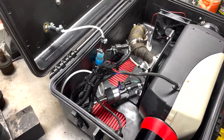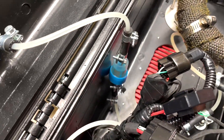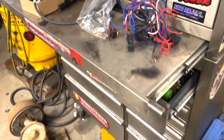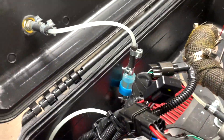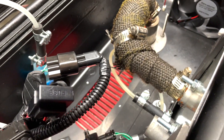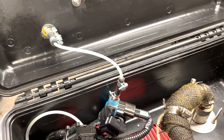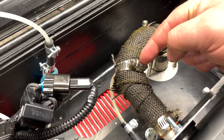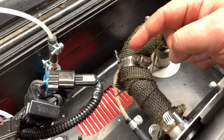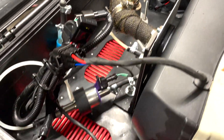I forgot to mention we had a pinhole leak, and to correct any further issues I got this rubber hose that we're going to cut, splice down the middle, and put over top — especially on this line right here. The issue was when the tank flooded with diesel, this line was a bit longer, and even though I had the exhaust wrapped, the band got hot enough that the fuel line touching the metal band put a pinhole leak in it.